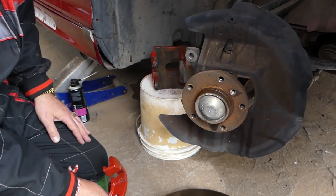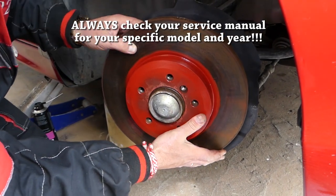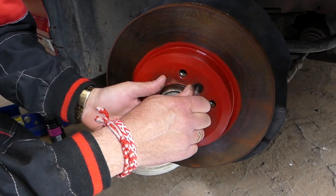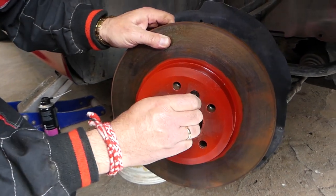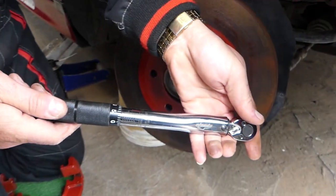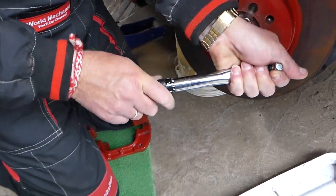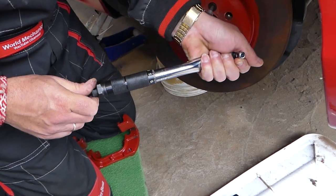First, we need to install the roller — it's right here. For that bolt we'll need to use the small torque wrench. This retaining roller screw bolt needs to be at 16 newton meters — that's what we found for our BMW — which is also 12 foot pound. Always store your torque wrenches at the lowest setting, otherwise you're going to ruin them and they will not be accurate.